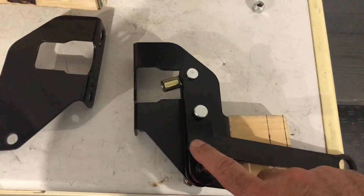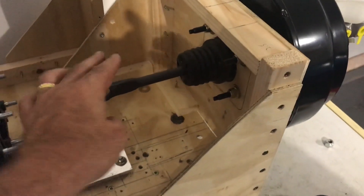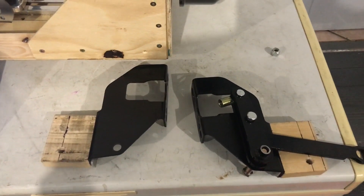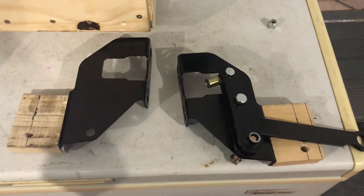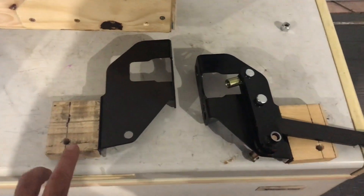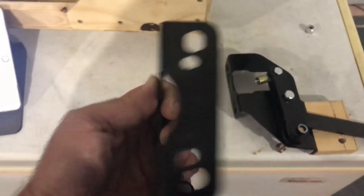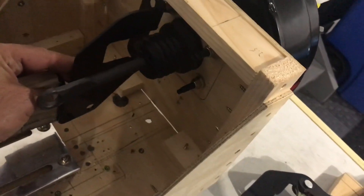I decided to use this particular arm in my solution. Looking at the Camaro brake booster, it's very long and has a ring — I could have chopped it and threaded it, but from a safety standpoint I didn't know what that would do to my ability to pass safety inspection or what the side effects could be. So I came up with a solution that would mount this bracket to the brake booster and just move the mounting hole back. I drilled a couple of extra holes, ground it out a little bit, and was able to make it fit quite nicely on the brake booster.